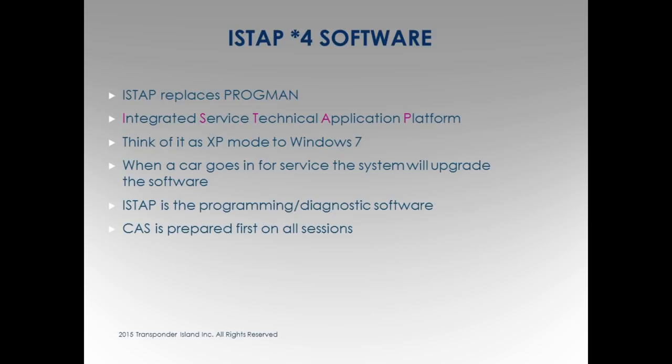Make sure if it does ask you if you want to downgrade the software in the car, what you're doing is changing the software version on the car. So let's say it's got version 53 and the software only works with version 48, they'll downgrade the software on the car to 48 so you can program the key. If you do it, make sure you put a power supply on. Not a jump, just make sure you get one, because if you start flashing that car and something goes wrong, you buy computers, okay? A new BMW has 108 computers on it, some of them, and then some. You don't want to be buying computers, okay? I've done 13 computers on a car, all in excess of $1,000 a computer. Don't go there. Don't touch it if you don't put a battery supply on.